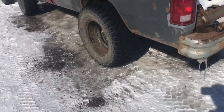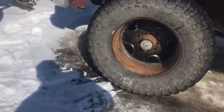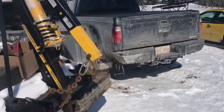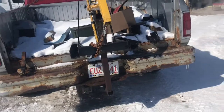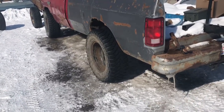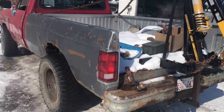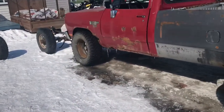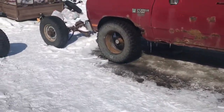These tires — the Forcer CF3000 — they're not very good tires. They came off my Ford. I put some Goodyear Wranglers on it now and took these off because I just couldn't get them balanced. I tried three different times to get these tires balanced and they wouldn't — they were wearing unevenly, they wouldn't balance, they were shaking the truck apart. Now I need new tie rod ends and track links. But on this old truck they'll be fine — it's not gonna see any highway speeds. And they're not hub-centric wheels anyway, so it's not gonna balance very good.